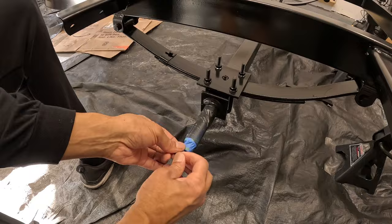So the first thing I want to do is pack my bearings with grease. I'm going to use a bearing packer for this rather than doing it manually, because time is important and this tool is cheap — I think it was only about $15 on Amazon. It saves you a lot of time and hand ache. I'm going to push this down, get the grease pushed up through the bearings, get both of them greased up, and get them inside the hub. You can now see the grease pushed right through that bearing all the way around. I'm going to take some of the excess grease and grease up the outside of the bearing and also drop some grease inside the hub. To prevent this video from getting too long, I won't go into all the details for installing new hubs and bearings — click the link at the top of the screen for the complete end-to-end process.